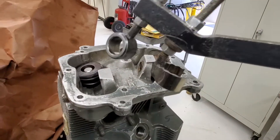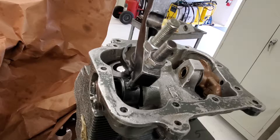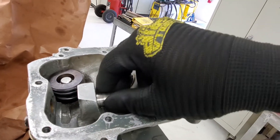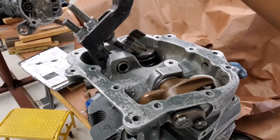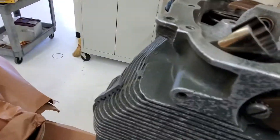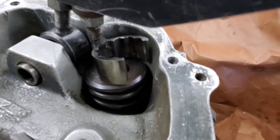I'm going to get this tool and put it right here in between. I'll put this shaft back again right here, and I'm going to be putting this compressor tool right there. I put it in like that and then I gotta compress — I gotta compress on the valve just far enough so I can remove the retaining keys.